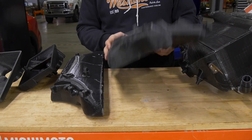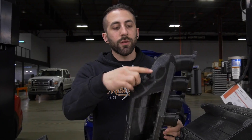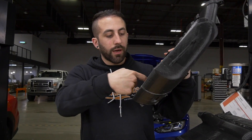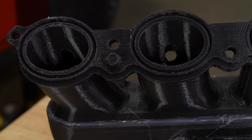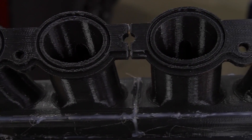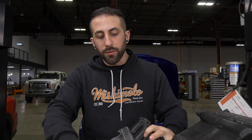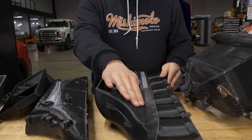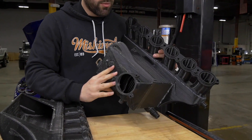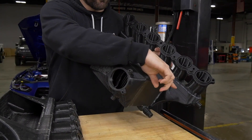To make matters worse, you have the cutout for the oil filter housing as well as these other little bracket cutouts which are going to restrict your flow going inside. When you have inconsistent flow between runners it creates all sorts of problems — basically you have one cylinder making more power than another. So in order to make up for it, you can see this iteration is flat on the bottom, and on this iteration I was able to add a little bit more room right here to add a little bit more airflow to compensate.